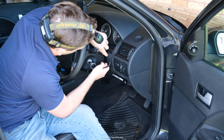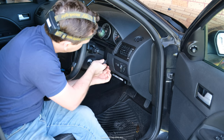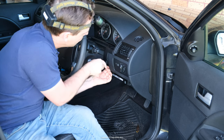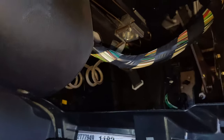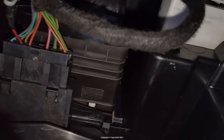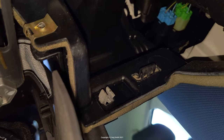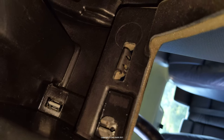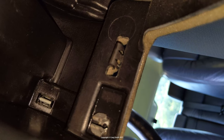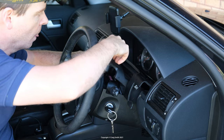Once they're out, this part of the disassembly just pulls out backwards toward you, but it is clipped in quite well, and if those clips haven't been worked before they might put up a good fight. It can be hard to get a good grip because there's nowhere really obvious to put your fingers to pull. If you're having trouble, you can access the clips from the back. You can see the right-hand side one and on the other side, recessed in there, is the left-hand side one. I sprayed these with a little bit of lubricant to help them, and it popped out next time I tried.